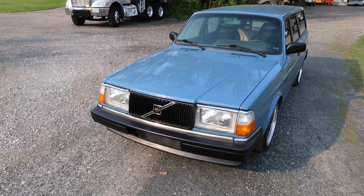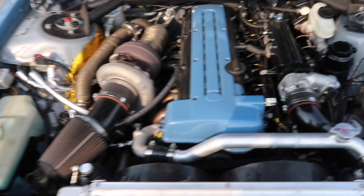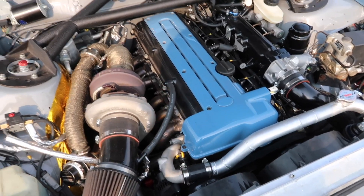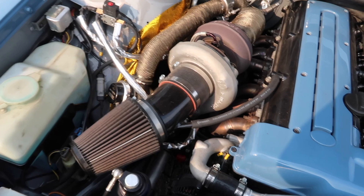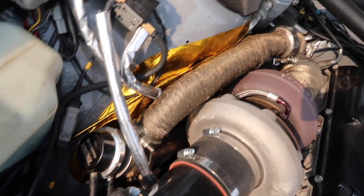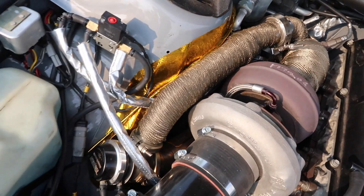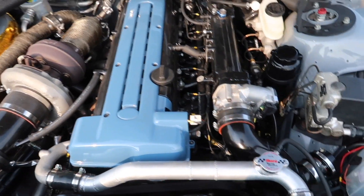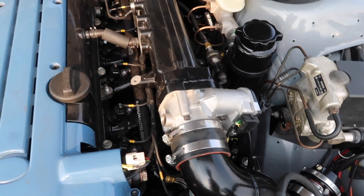Let me show you what we have going on under the hood of this thing — 2JZ. This is a VVTi 2JZ that we got from an engine importer. It's got a set of cams and a valve train refresh: new valve seals, new valve springs and retainers, and a set of upgraded camshafts. It's got a BorgWarner S300 turbo, full race manifold, twin TurboSmart wastegates plumbed back in — because this is a civilized vehicle, so no wastegate dumps here. We had all the valve covers, intake manifold and such powder coated to clean it all up, along with all the intercooler pipes powder coated to match. We installed a Bosch drive-by-wire throttle body onto the factory intake manifold.